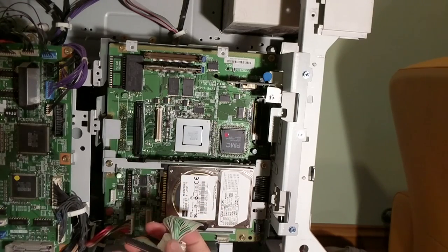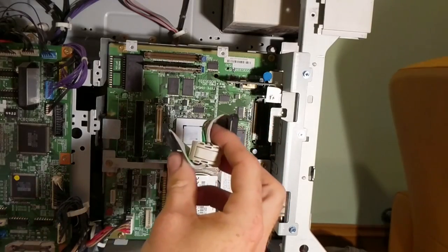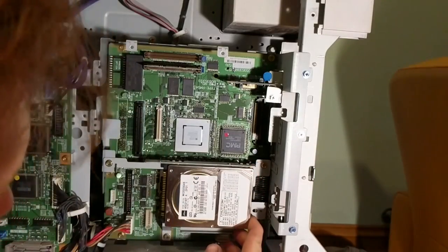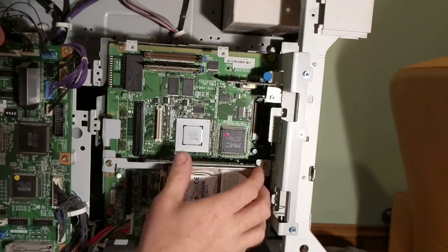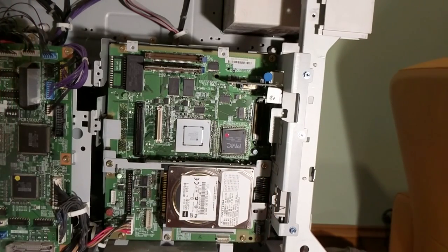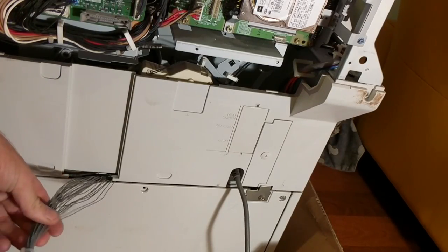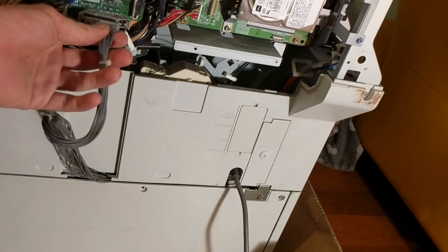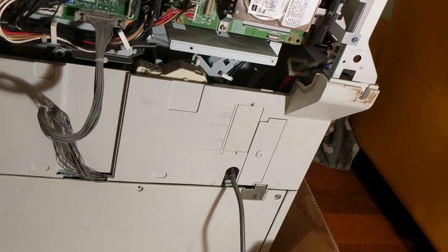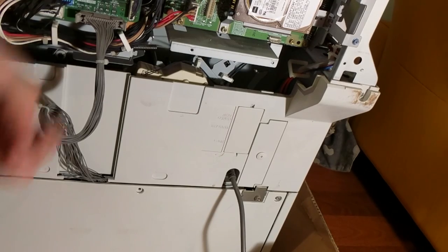This is very, very strange — I haven't seen a connector like this. I'm assuming this is some kind of laptop IDE, but the commenters will be sure to correct me. I think they've actually screwed this in, which is completely inappropriate. I haven't had to use a screwdriver to remove a hard drive in the last 10 years. I would love to know what this other connector does. I don't understand why you have all these loose conductors fed through to the bottom of the copier going to the main board. Thankfully that does only go in one way. I assume that has something to do with talking to the paper trays because it's going fairly low down on the copier, but to be honest I really don't know.